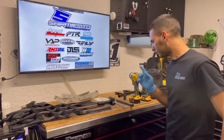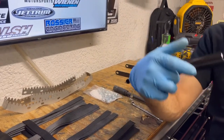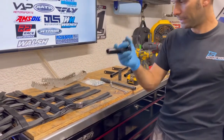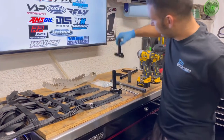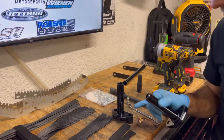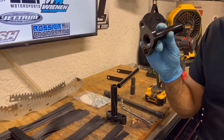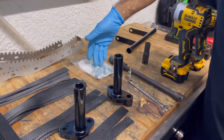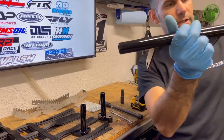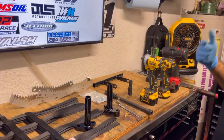I'm going to go over a couple of tools and also the hardware. We've got our nerf bar, the monster pegs - the actual peg that goes into the tube. This one that has a collar actually goes on the brake pedal side so it clears the brake pedal. There's a left and a right. If you put it upside down, you'd be dragging it badly on the ground. We also have the bolts to bolt the monster pegs down and the front support that goes into our motor mounts to the frame.